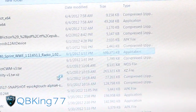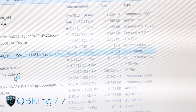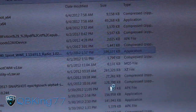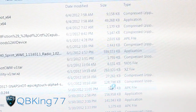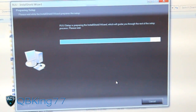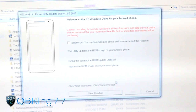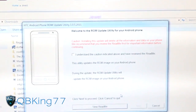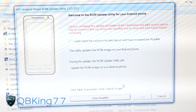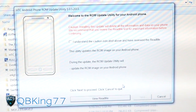Make sure your phone is plugged in with USB Debugging enabled and set to Charge Only. Hit Yes when prompted. It'll load up like it's installing something - you'll see RUU Setup going on. Here is our RUU, the ROM Update Utility. Again, this is going to wipe all your data - I don't think internal storage, but I left an annotation at the beginning letting you know if it does or not.